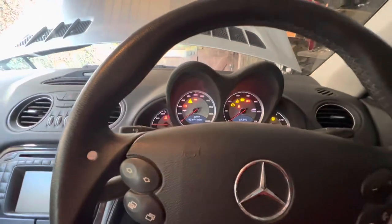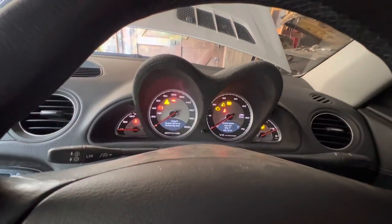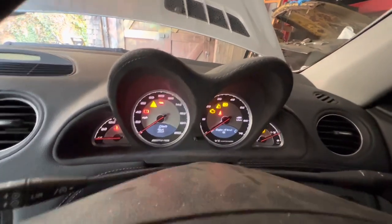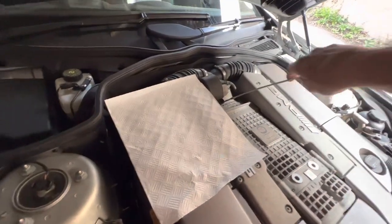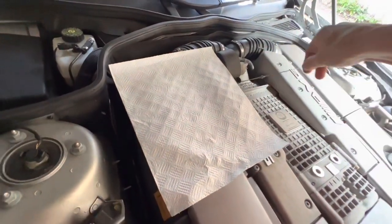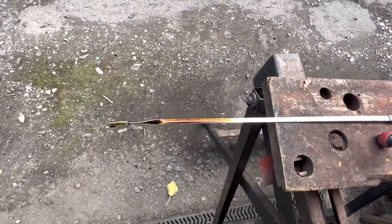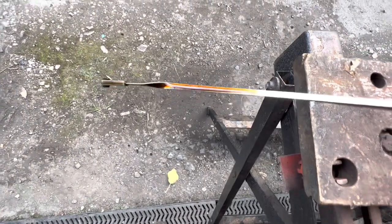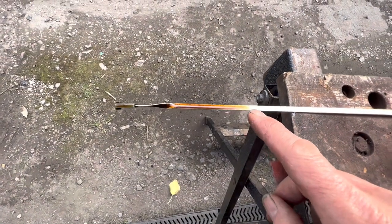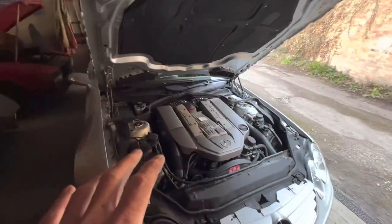Back in the car — key in the ignition, lights on, down arrow — and there we go: engine oil level okay. We've added one litre and now we're getting the correct reading. Let's also check on the oil dipstick. After putting a litre of oil in, we're at about the 115 level on the dipstick. If you turn that over it gives you an extra centimetre of oil, so about 115 on this dipstick is a full tank of oil.